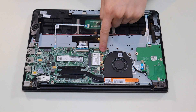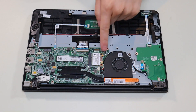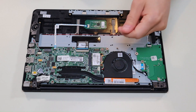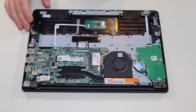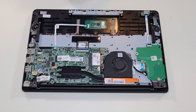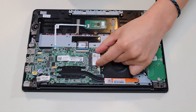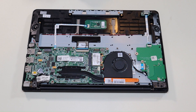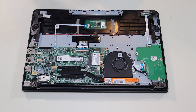There's your Wi-Fi card right there. It's held down by a single screw, and then your antenna wires snap onto it here — black on top, white on bottom — and the antenna wires run across your fan up through this hinge assembly. These antenna wires are just snaps; they snap on and off, but they need to be at an exact 90-degree angle to snap on. If you don't have them at the right angle and you push too hard, you can damage those connectors. So be patient — you will be able to get that back on if you have it at the right angle. Once it's unscrewed and unsnapped, it can slide out of that port. I'll have the Wi-Fi card specs below in the description, and I'll also try to have a replacement option in that parts link.